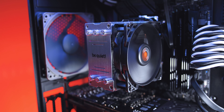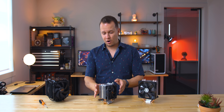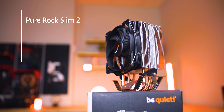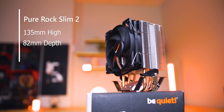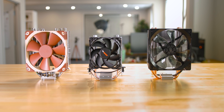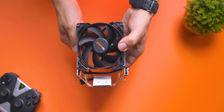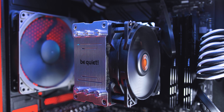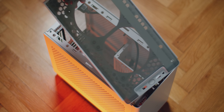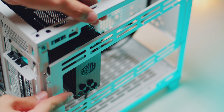92mm coolers are nothing new on the market — there's Noctua, Be Quiet, and a bunch of other companies that have come out with these over the years. But by far, this might actually be one of the least expensive ones from a big-name manufacturer. This thing is freaking tiny — it's only 135mm high, 82mm deep, and 97mm wide. That's a lot more compact than a typical tower-style heatsink like the Noctua U12S and the 212 Evo. This is actually perfect in height-restrictive situations where you might want a cooler working with the case airflow rather than against it, or if you have a system that doesn't need an AIO. A perfect example is the NR200, which can take a max cooler height of around 155mm — putting even the compact Hyper 212 series completely out of contention.